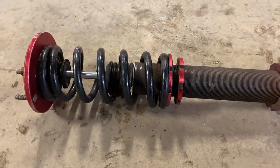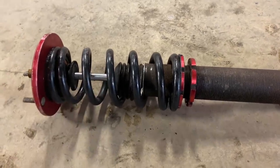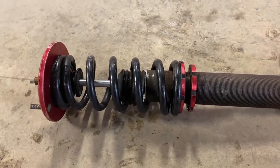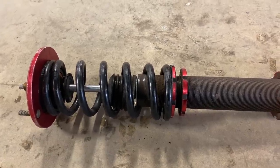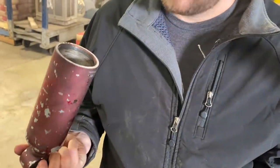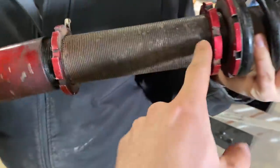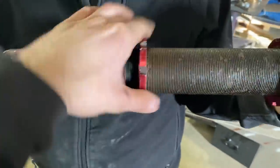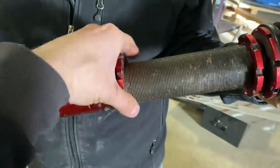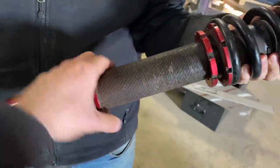So don't just go cutting any shock you find — the spring could be under a lot of tension and could kill you. Is this a screw all the way off? Oh yeah, that's how you adjust the ride height. Well now you just saw inside it — now we don't need to cut it. This part just threads up on here and then you adjust this collar depending on what you want your ride height to be. Dan, don't tell them how it works or they won't want to watch our next video.